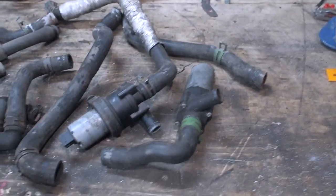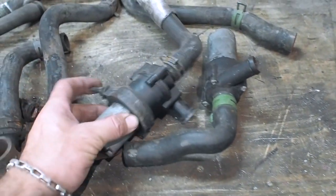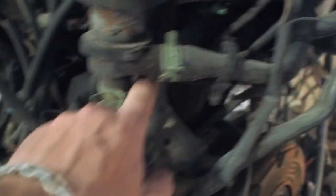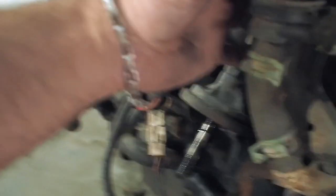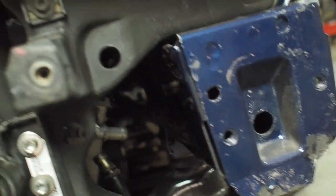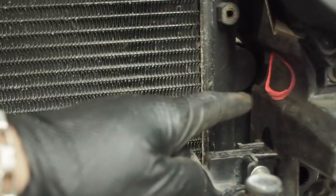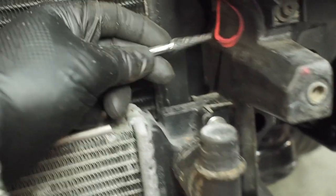I've got an array of pipes that need to be cleaned before fitting, and a couple of pumps — one even with a bracket. I'm also going to use the bracket from the GTD engine, which has perfect little mounts and I can isolate it with rubber. The hole I'm going to make leads straight to the charge cooler — the top one, not the bottom. I'm using one of these carbide bits designed for aluminium, bumpers, and plastics to make a nice clean shape in there.